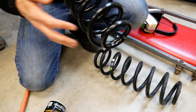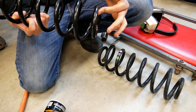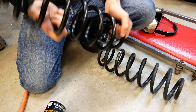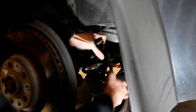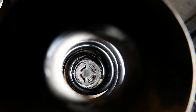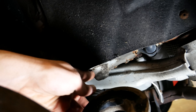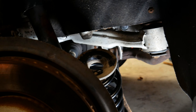We just need to seat this down in the seat that is on that suspension arm, and to do that I like to put a little bit of lubricant on here to help it pop into the rubber seat. This does have a specific orientation — the bottom of the coil spring needs to go against the tab on that rubber stop at the bottom. To get this spring back into place we need to line up the top of this rubber part with the little piece that comes down off of the chassis of the car. It'll just slip into place and then we can go ahead and get the suspension back together.